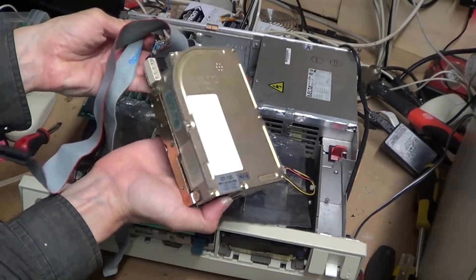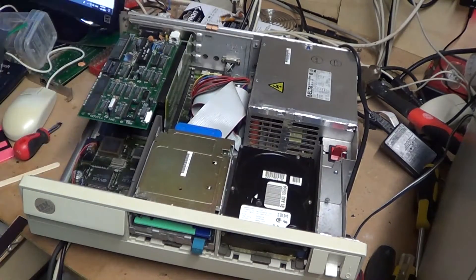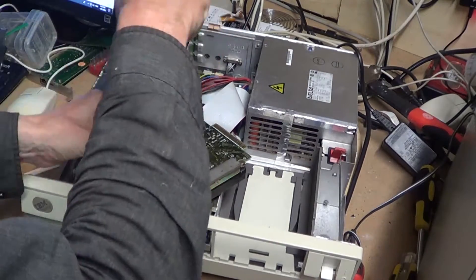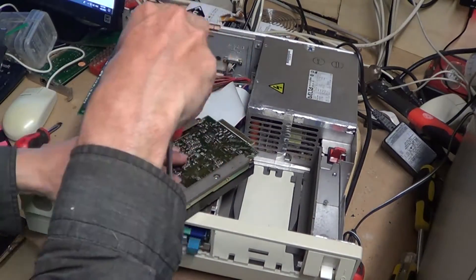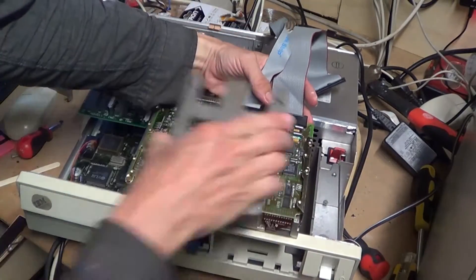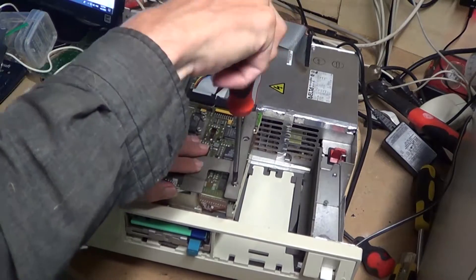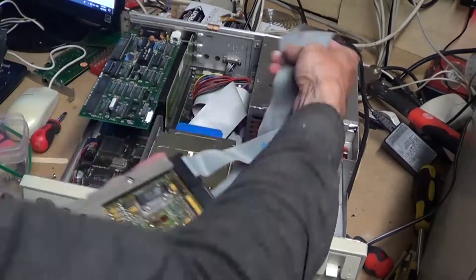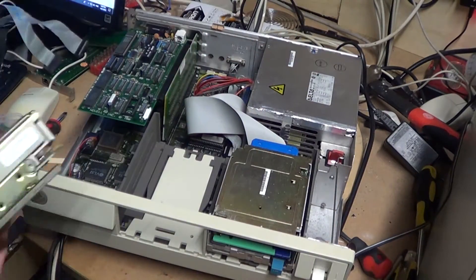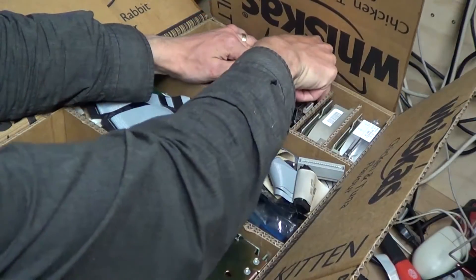This is a Seagate ST125, just a normal MFM drive, and we're going to pair it with this ProCom RLL controller I found. It's got a Molex connector for power, and using RLL means the drive will now be 30 megabytes, which is actually an upgrade for this machine. The ST125, or a modified version of it, was actually sold new in these machines, so it has bolt holes that perfectly line up with the PS2 bottom bracket — I did have to use different screws, but it bolted together nicely. The MFM cables were a little short, so I flipped the drive around to be closer to the controller. Once powered up, it was time to do a low-level format — but unfortunately I didn't get the noise I was hoping for. This controller reported the entire drive as all bad sectors, so I went through my box to find other drives.